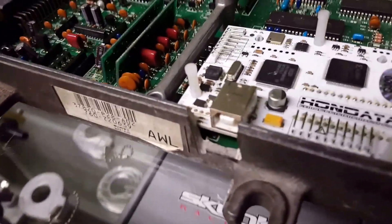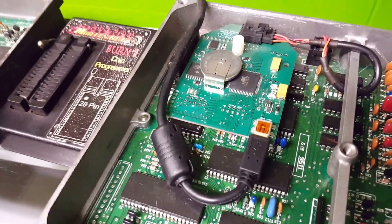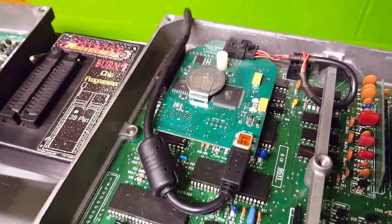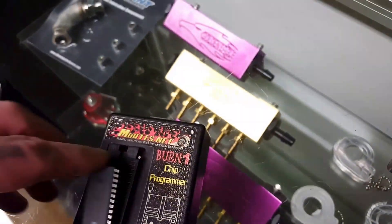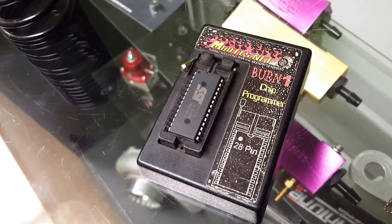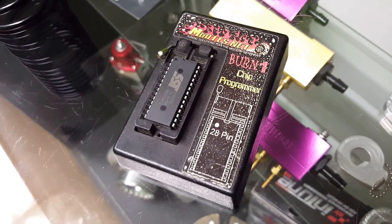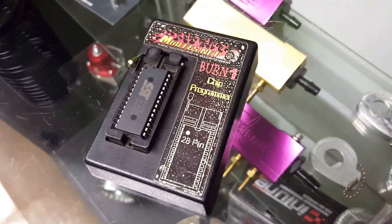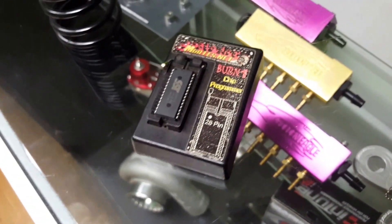Here's an S300 that's installed with its connection. The Neptune board has a cable as well that runs to our laptop, and we're able to make live changes while we're dyno tuning. When we're done, we save the file to our laptop and then we use this little chip burner. The chip sits inside the chip burner and we take the tune and burn it to a chip. This is basically how base maps are created.